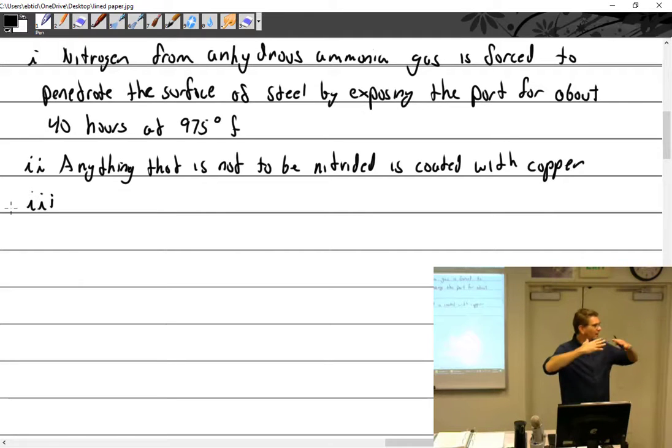You want a little bit of flex in the camshaft between the lobes so it doesn't crack. The lobes and bearings are nitrided because of the tremendous pressure — it's metal on metal with a ramp pushing everything, so you want them hardened. Your rocker arms are all coated with copper except for the foot and the ball socket in the back.